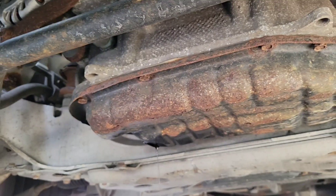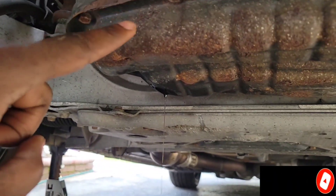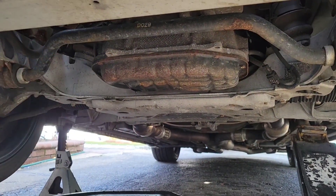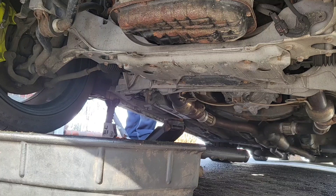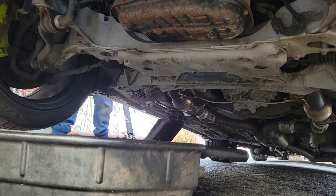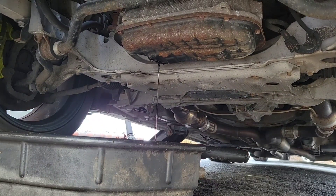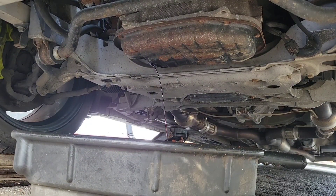Remove the oil filter. The way we jacked it, probably some oil is still over here. You could jack it over to the other side, take out the stand, and more oil will come out. I'm gonna show you — take the jack, bring it over here, jack this up a little, take this out and you're gonna see more oil come out, just in case you want to do your oil change and take all the oil out. See what I was talking about — you could let it tilt some more if you want, but it should be good.